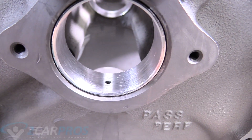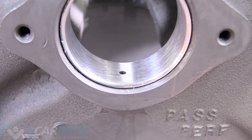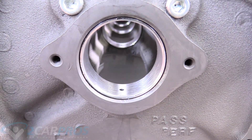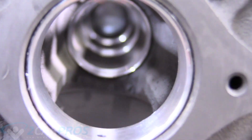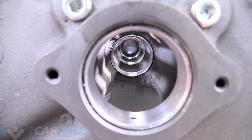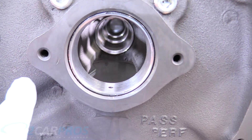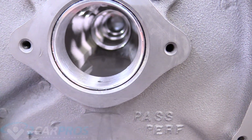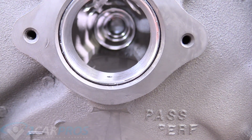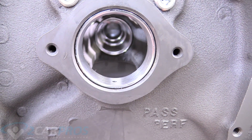This is the front of the engine. These are your cam bearings here. You see that little tiny hole? That is where your camshaft actually gets lubricated between the cam bearings, and you can see them all the way back in the mains. You want to make sure that all of them are oriented the right way up, pointing straight down so your camshaft can get oil. If these are off even a little bit, send it back to the machine shop.